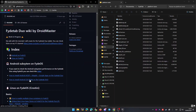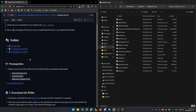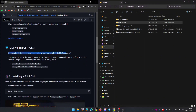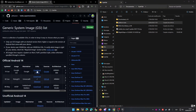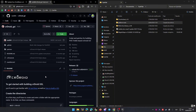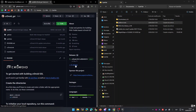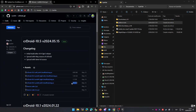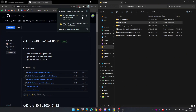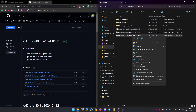Now I want to show you how to also install some GSI ROMs. These ROMs are a bit more experimental on this tablet, but I recommend checking them out. The first thing to do is download one from this list — you can see we have a lot of different projects like LineageOS, but I'm going to select CR Droid because I've tested this ROM in the past and I think it's quite good. The only problem is that we need to select the lighter version of all the ROMs, so they won't contain Google Apps, but the system partition is a bit small so there's no other way.